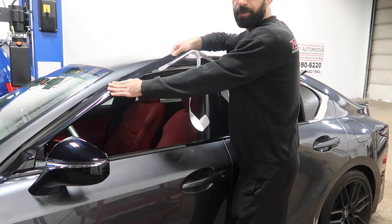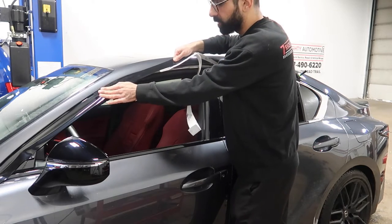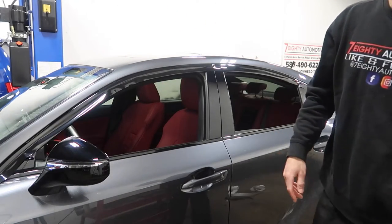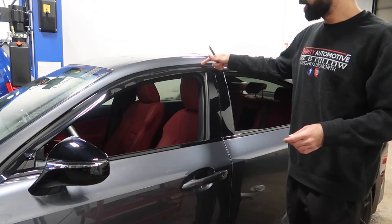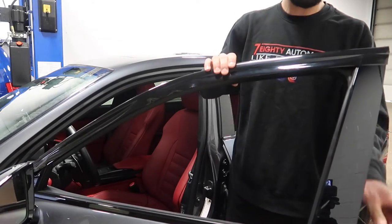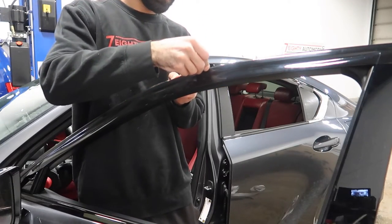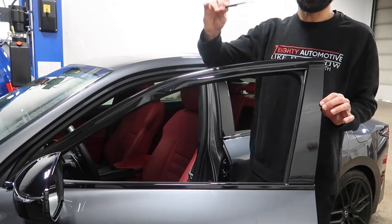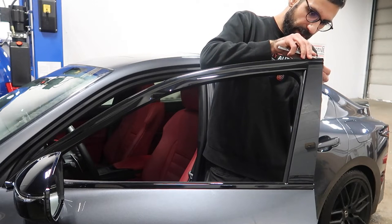Here I'm pulling with my right arm and directing the vinyl on which way it needs to go. It's going to be a little different here — I'm going to cut the middle so I can open the door and tuck the top in a lot easier, then make my cut on the bottom. Now I've got full access to the top part where I can pull the rubber back and tuck the vinyl in, then cut off any excess vinyl with the knife.